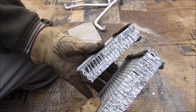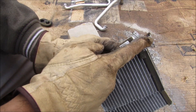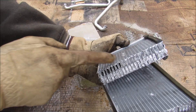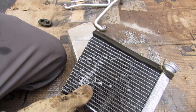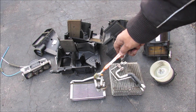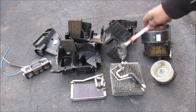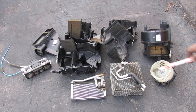This here is the heater core cut open — it's pretty much like a mini radiator. The hot coolant will come through here and then it will go through individual little passages. When it goes to the other side it will collect and go back out to the engine. One thing I find rather inefficient about this design is that air will come off of your intake and go through your air conditioning before it goes over to your heater core to get heated. So if you've accidentally left your air conditioning button on, your air conditioning is running to cool the air while your heater core is struggling to warm that air.